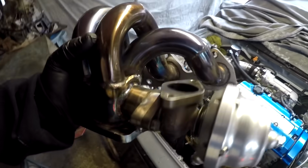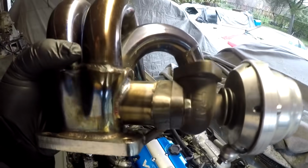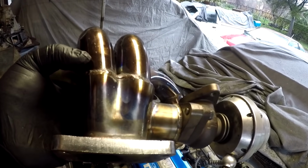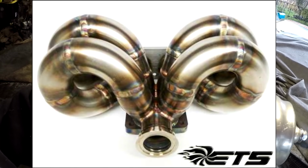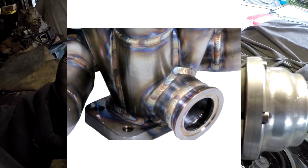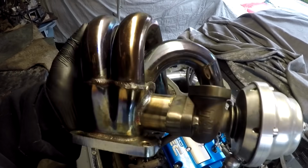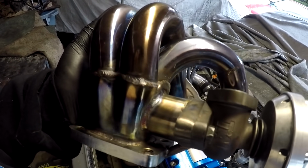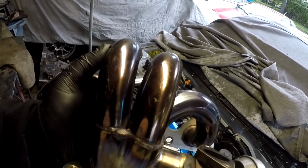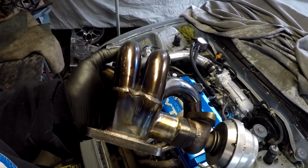Got the wastegate bolted to the turbo manifold. I'm gonna give you guys a better look at this wastegate placement. Now, I read a comment today that stated this is not gonna work. If you look at the old school ram horn, or fabricators before doing teardrop wastegate style, it used to just come out like this. Spoolin' Performance had it like this, Full Race had it like this, and just coming out right there is definitely a lot better than the check that it was doing before, where it had to go down and then back up. This one right here should work out, if not contain the boost, a lot better than what it was before, if that makes any sense.